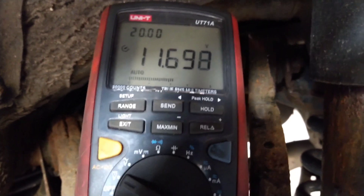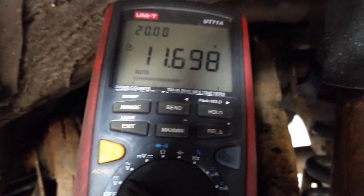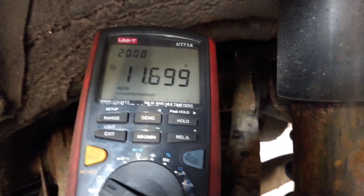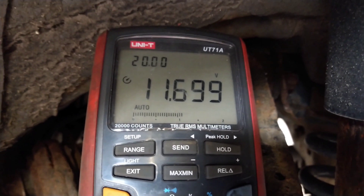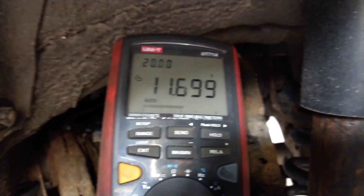Basically no change. I'll go to the other side and do the same test again to see what we get on that side. So that looks like it's a faulty sensor. As I say, some of them you can do the same test with a magnet near it. This is using your own car, the ignition on, and a multimeter to do the test.